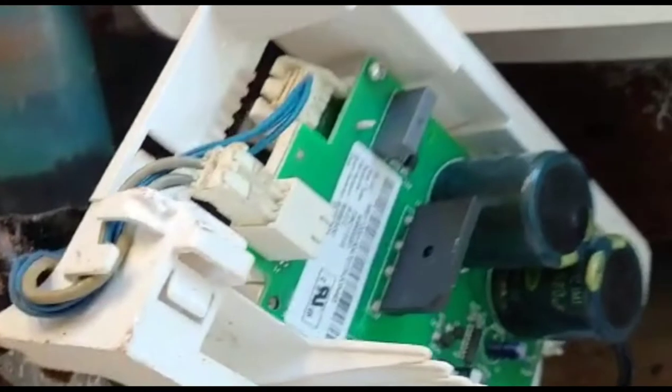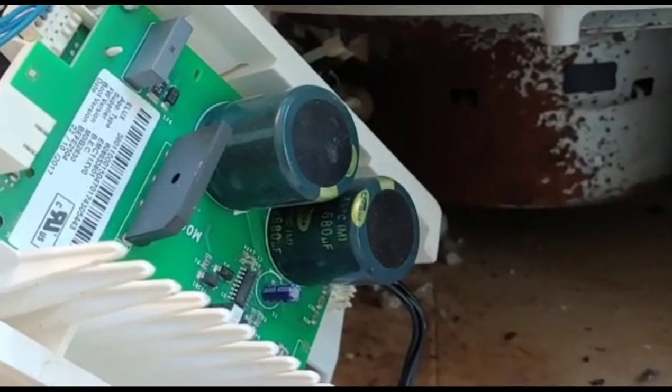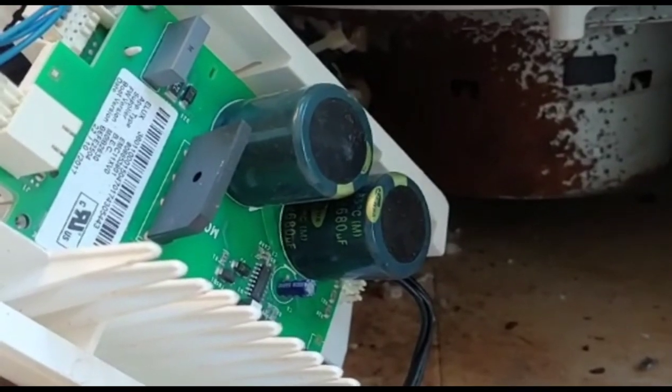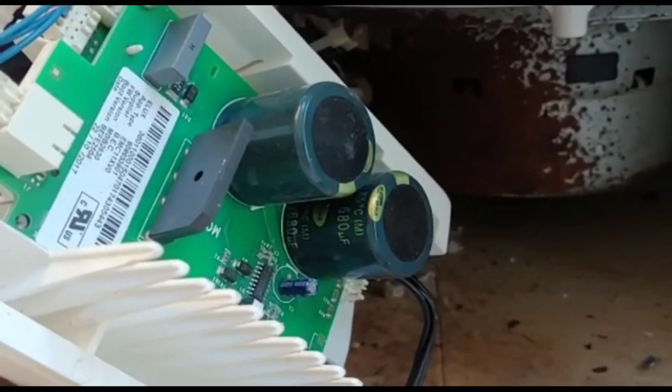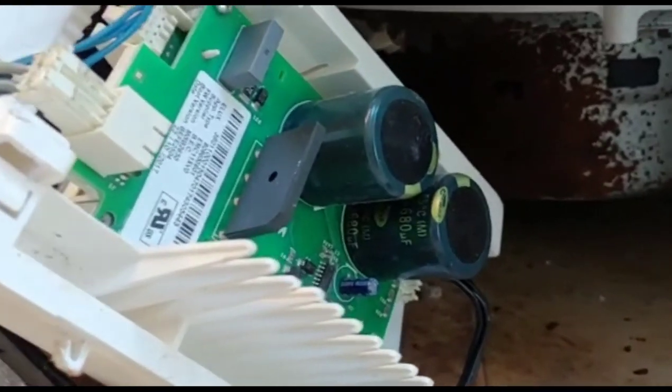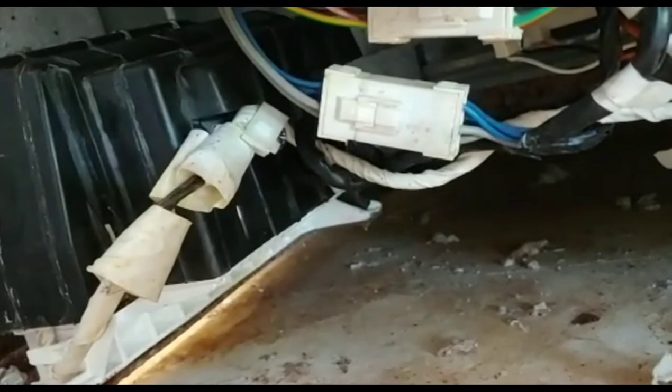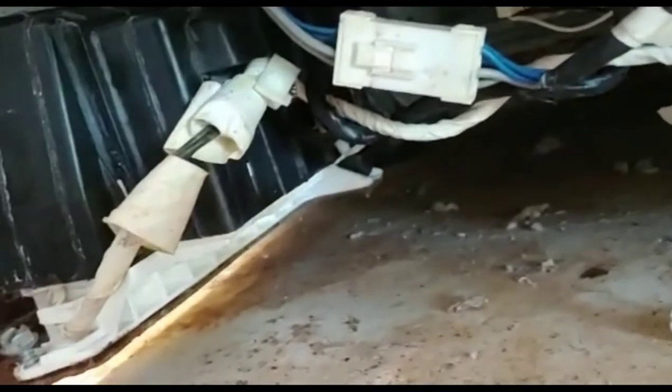Now let me disconnect the contacts. There is no power on it. This new board solved all my problems — the machine was really not doing anything, acting randomly: sometimes fills up, sometimes stops, sometimes doesn't spin — all sorts of weird issues. There was oxidation. My lower control board is back in place and secured. I had to change the screw because the old one was so rusted. The contacts are clean now — let's hope it's working.